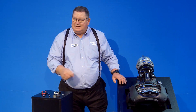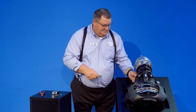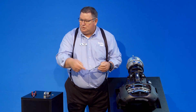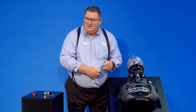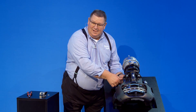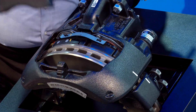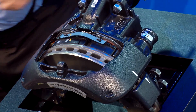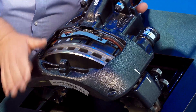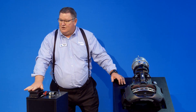It's called the shear adapter because it's designed to fail if you over-torque the adjuster mechanism. If you fail it, you can buy a new one and put it back on. We do that so you break the adapter and not the adjuster mechanism. Just like a slack adjuster, when you back it up counterclockwise it clicks; when you turn it out to adjust, it's quiet. As we back it up, the tappets will retract in. Once we do that, we can pull the pads out — here's one pad. Push the caliper inboard, then pull the other pad out. Now we've got both pads out.